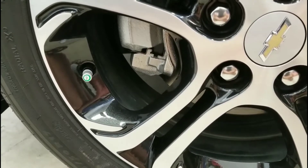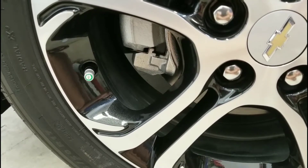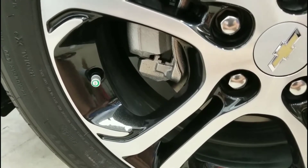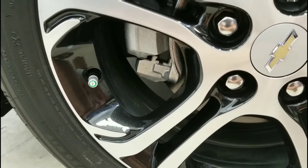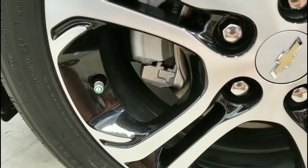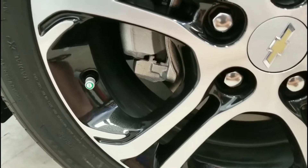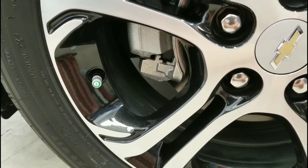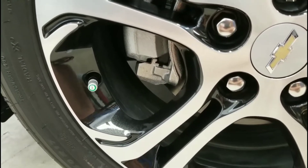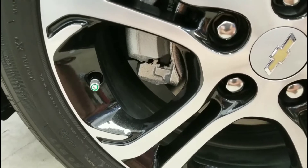The problem with water is it can corrode your rim. If you've ever taken a wire brush to a motorcycle rim or changed tires, you know what I'm talking about — usually end up brushing off rust. Also, water in your tires can make them hard to balance sometimes because the water sloshes around inside the rim. Some air compressors, when filling your tires with air, have water coming out, which is how water gets inside your tire in the first place.